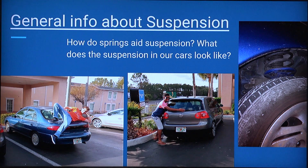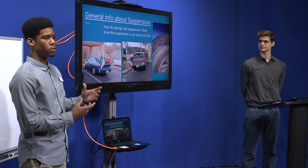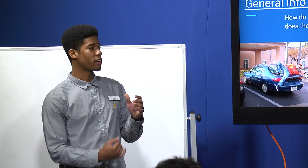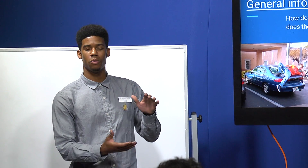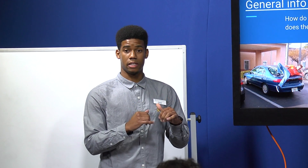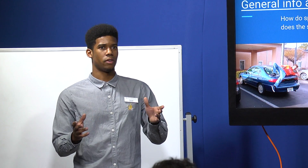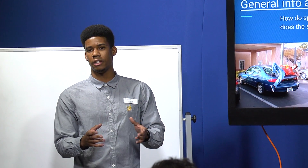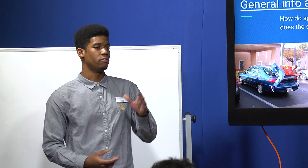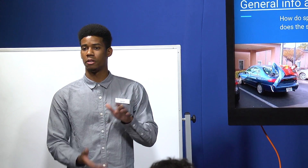What's in between that spring is a damper system. In the most simplified model, it's a cylinder with a very viscous fluid within it, and there's a piston driving up and down as the wheels compress and decompress. Through the piston at the top, there's a disc with holes. The viscous fluid is forced through those holes, slowing down how fast the spring will compress or decompress.